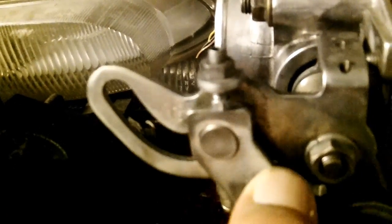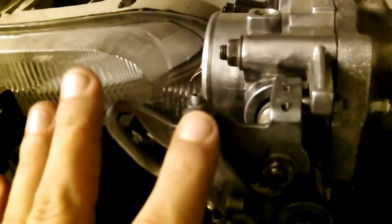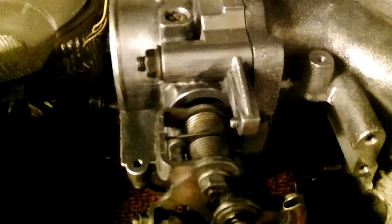There are two screws. This up here is going to be your hinge adjustment, and it is really tiny. The only thing that this screw does is make sure that this stops where it should. I don't recommend that you try and adjust this — this is usually set perfect. Don't mess with that one. The one that you want to mess with is this one up here; that's the throttle stop screw for the V6. And as you can see, that's what a throttle stop screw does — it's adjustable. So now the butterfly valve is fully open and fully closed: fully open should be 90 degrees, fully closed should be reporting at 0%. That's how your throttle position works.